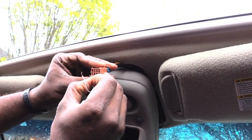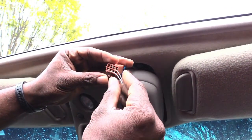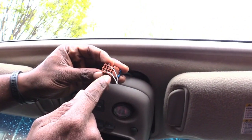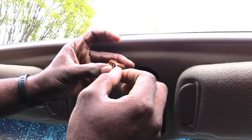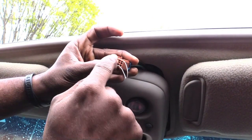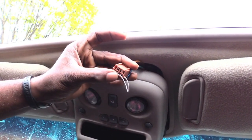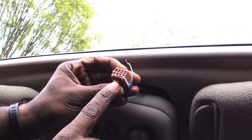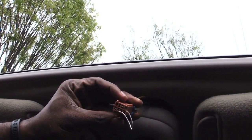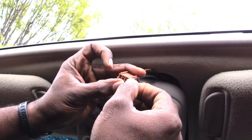All cars will be different, but on a Chevy vehicle it'll probably work the same. Stick the wire into a slot that has a little metal piece on the bottom row, then take the top part and stick it into the first hole from the passenger side on the top row, making sure the piece that snaps into your switch is facing the bottom. When I hit this, it should close the moonroof — yeah, you see that. I'm just holding it in; if I take it out it stops, stick it back in and it's closing.